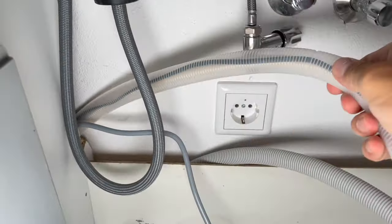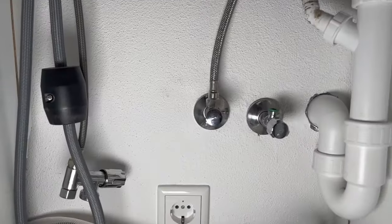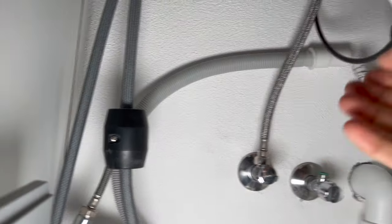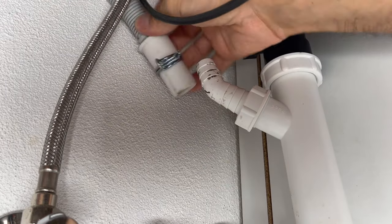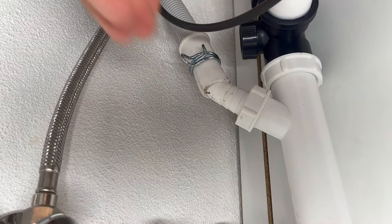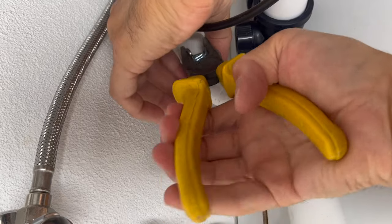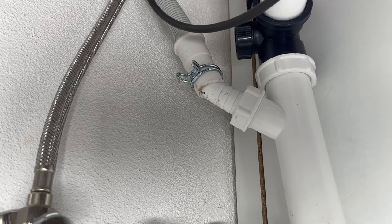Slowly and gently push your dishwasher in and pull on the lines. Now we can go ahead and make our attachments — let's do the sewage hose first. For that we're going to need the clip. Get the clip on there, slide the sewage hose onto the nipple just like that, and squeeze the clip with the pliers. Put it down on that connection.